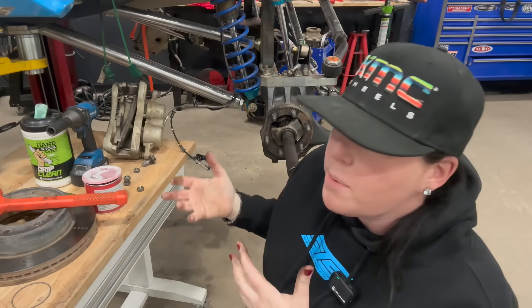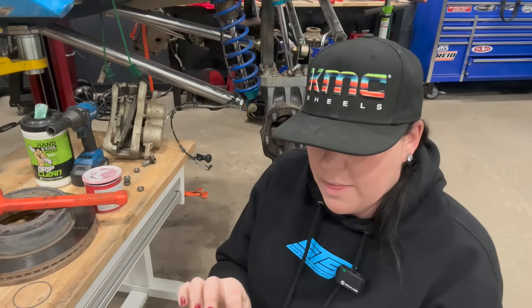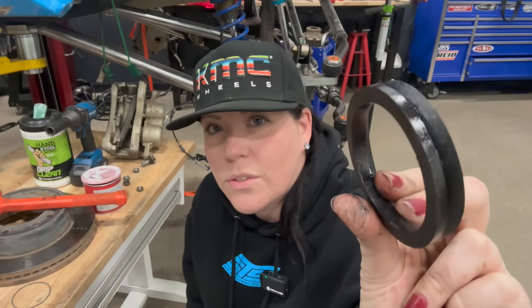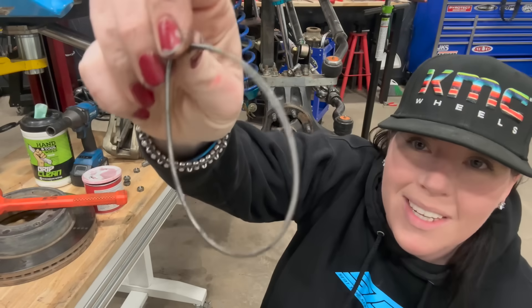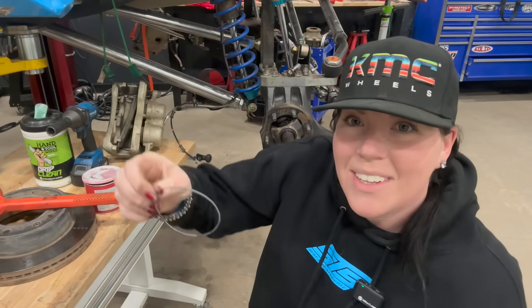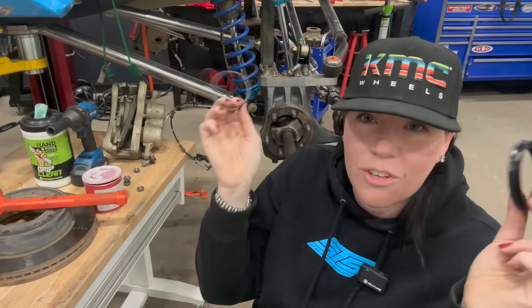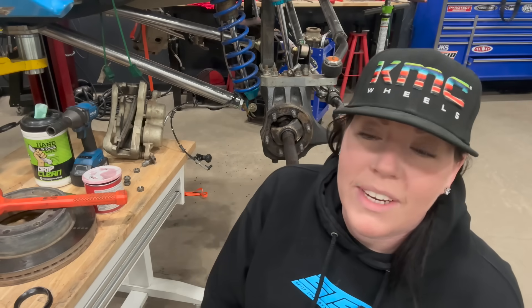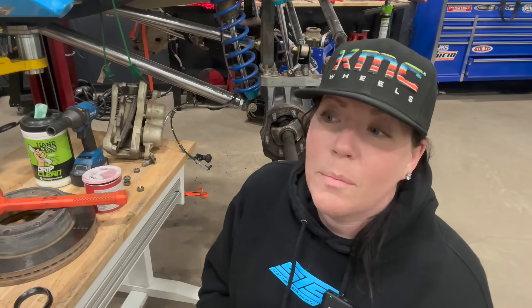You just saw me put the hub on and take it off — when it came off, the seal at the back of the spindle came off and has a nice hole right there, which is not very good. And it came with this spring from the seal at the back of the hub. Yeah, it's not supposed to be anywhere near this crazy. So I'm going to have to go to the store to get some seals — I don't have any of those; they're always available at the stores near me so I don't normally carry them. But before I head to the store, I'm actually going to go on the driver's side and take that apart just in case I need anything else.